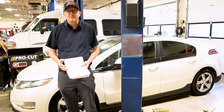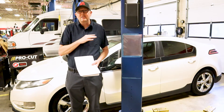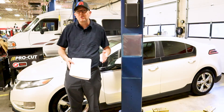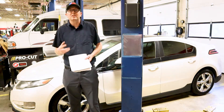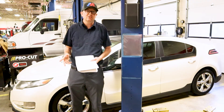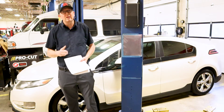However, I did find out that was not the problem — the traction battery was actually fine. When I got it back to the shop, everything was black and didn't light off anything. So whenever you get an EV or a hybrid, it doesn't matter which one, but especially a Chevy Volt, you need to check the 12-volt battery. There is a 12-volt battery that runs the 12-volt system in these cars.